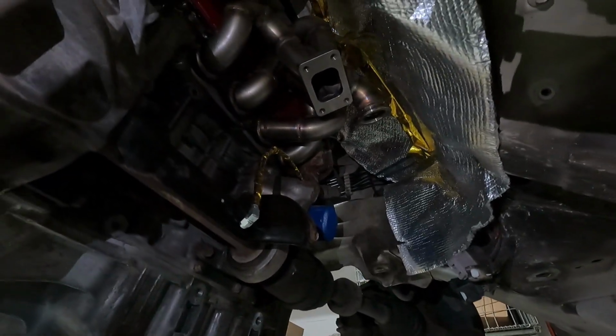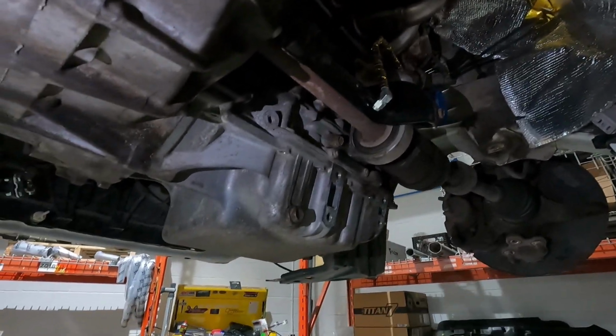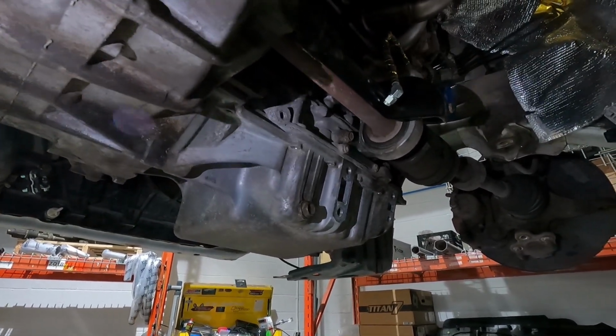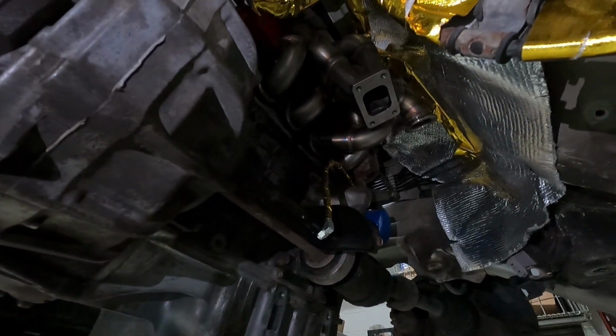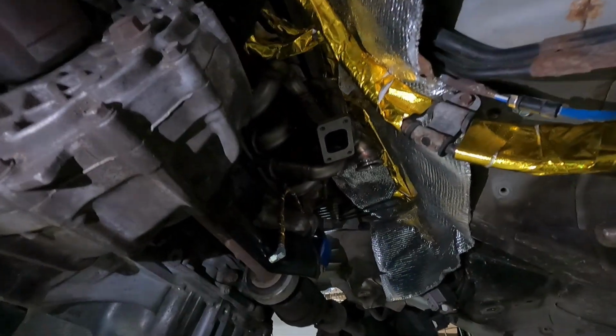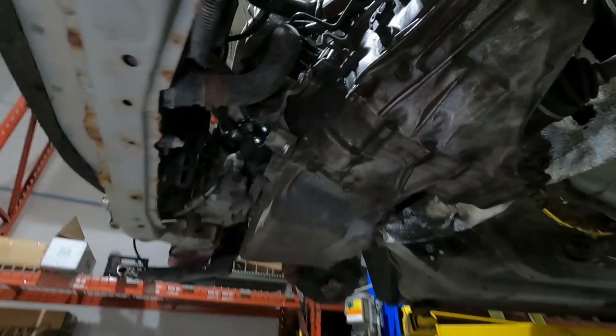He's already run the oil line, the turbo manifold's installed. He's just about ready to take off the oil pan, drill it, and weld it for the return for the turbo. And then he'll start putting the turbo kit together. The turbo on, the wastegate, the downpipe, start connecting things, install the intercooler piping.